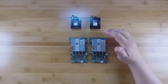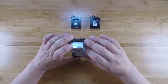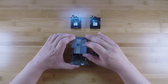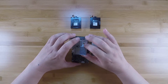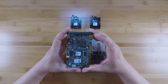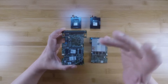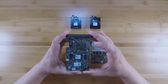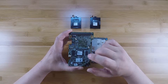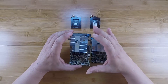Now with that said, one caveat is that this card — the same one Dan sent me, and I've already sent Dan back his card as promised as a gift for contributing — has Dell part number 5CT6D. That's really important. If you guys are out there trying to do this on your own, get this card. At least for me, this is the only card I've been able to figure out how to cross-flash to IT mode with the 2308 firmware. Those are the only cards I've been able to successfully flash to IT mode.